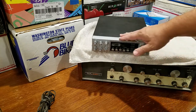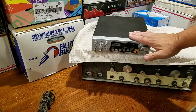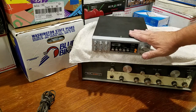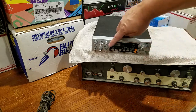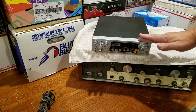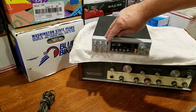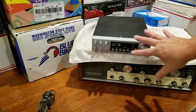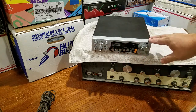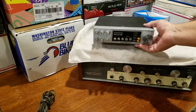And hermetically sealed in cigarette smoke. And when I say that, I like a smoker's radio. I really don't mind. You can clean them up inside. That's not a big deal. You can get rid of the cigarette smoke. But when they're hermetically sealed in cigarette smoke, the smoke itself stops them from pitting up and getting all messed up. So when you take this face off and spritz it with some citrus cleaner, these things come out like brand new. I mean, dude, this thing's awesome.